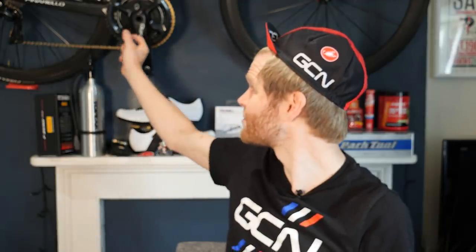That said, my personal recommendation is for a spider-based unit. And that's simply because they normally offer a very accurate measurement. It's a simpler place to measure power than a pedal. There's less going on there, there's less input strain. And in my experience, they just tend to last longer. They can be more expensive, but it's that classic buy cheap, buy twice adage. So in the long run, it can be more cost effective to buy a slightly more expensive power meter that's crank based or spindle based. But yeah, just something worth considering, I'd say.